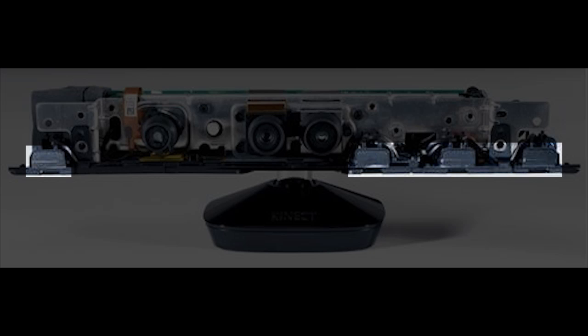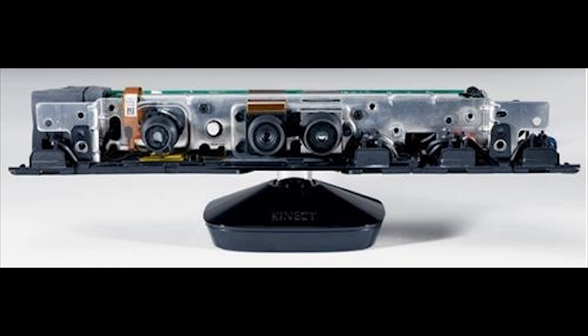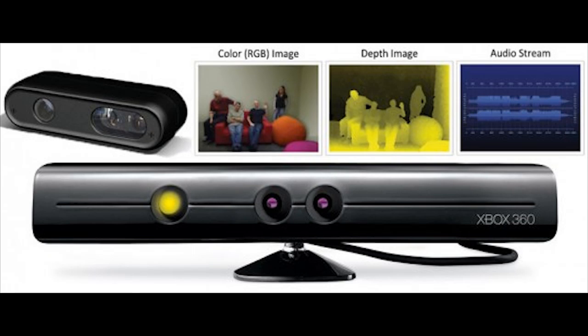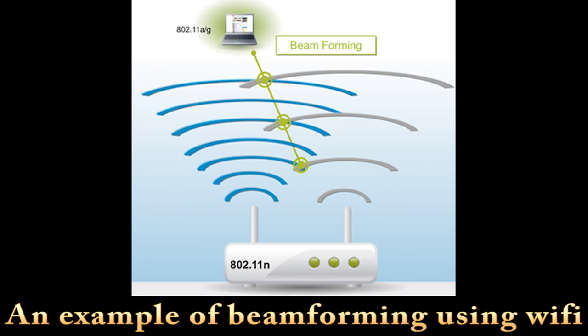adding another level to application control. This is accomplished with four separate downward-facing mics that are able to pick up reasonably audible commands from just about anywhere in the room. In fact, it's the placement of these mics that ultimately determine the length of Kinect's sensor bar. The innovative bit here is how, through an onboard processing unit and beam-forming software, the mics can block out ambient white noise and clearly understand individual voices.